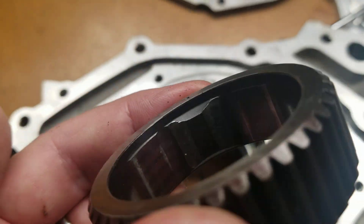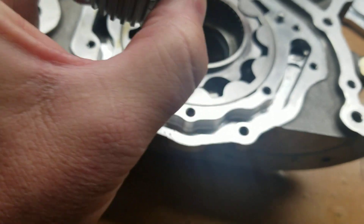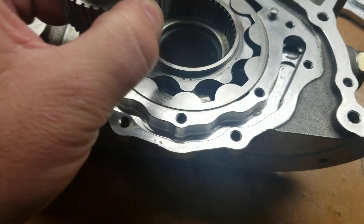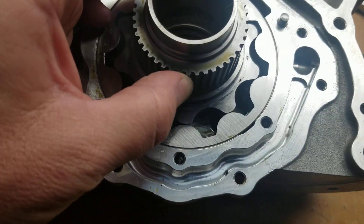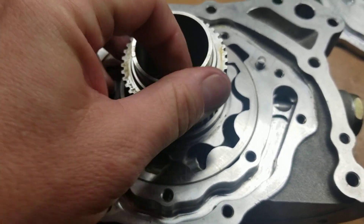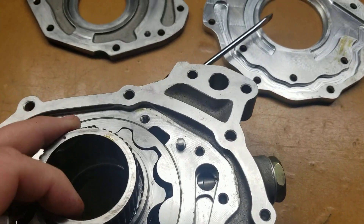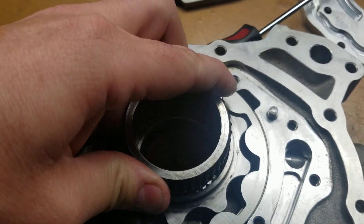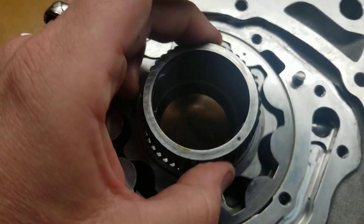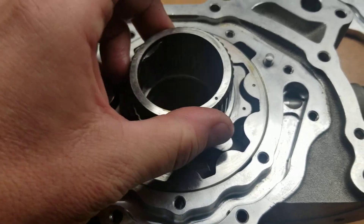This thing is no longer square. This is actually part of the spline drive section — one part of it that would go onto the crankshaft. We take this piece and it drops right in. This piece probably only goes in with some heat. What happened is it started to bind on the housing — it would not spin smooth anymore because it was pressing on the gear so much it was pressing it out.